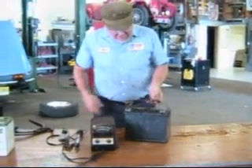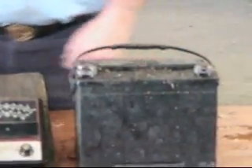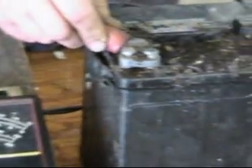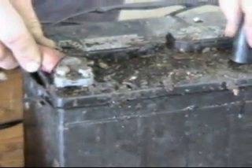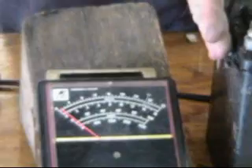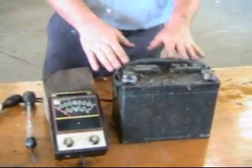Here's the type of battery you might have in your car — and it's all covered with dirt on top. Now if we take our voltmeter and go between the two posts, we can see around 12 volts. But if I take one lead and put it in the dirt on top of the battery — look at that. We're getting some current passed through, which means the top of your battery is filthy dirty and it's going to self-discharge. The secret to battery longevity is to keep them clean.